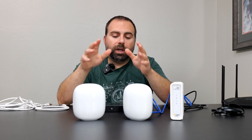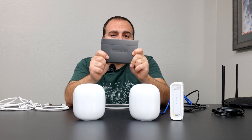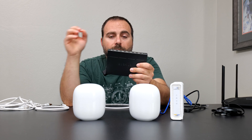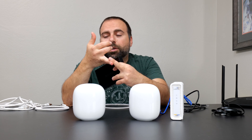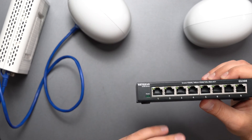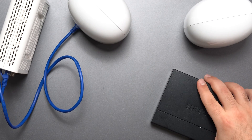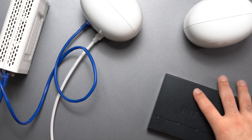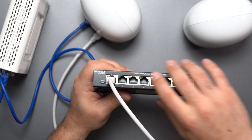The Nest Wi-Fi Pro doesn't have many ports, so if you have more devices to connect, you need an unmanaged switch — these are fairly inexpensive. An unmanaged switch is different from a managed switch: a managed switch can do extra things like set up VLANs, assign IP addresses, etc. With an unmanaged switch, the router controls everything, which is typically what you want. You connect the arrow port (left and right caret) on the Nest Wi-Fi Pro to any port on the switch — port selection does not matter.